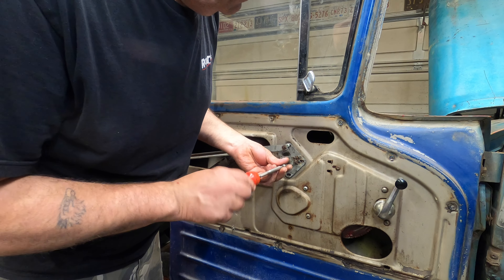If you've got to do your window, remember: roll it down a little bit, slide it backwards and then forwards and then out, and then you can replace it. If you've got to do your regulator, do the rest of these screws and slide the whole thing out — it's good to get this out of the way so you're not farting around in a confined space. You can pull that guy right out of there. I hope it helps you if you're looking at changing your window, pulling out your vent window, or changing your regulator with one from the wreckers.